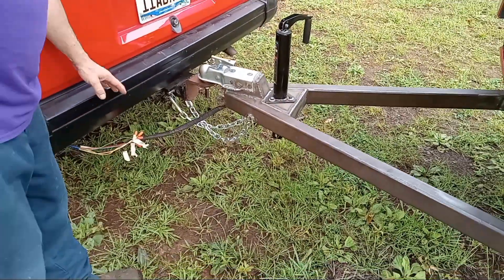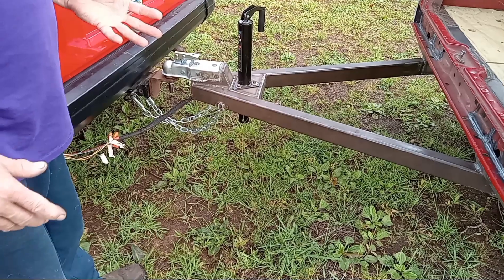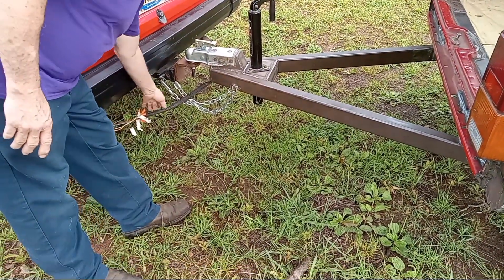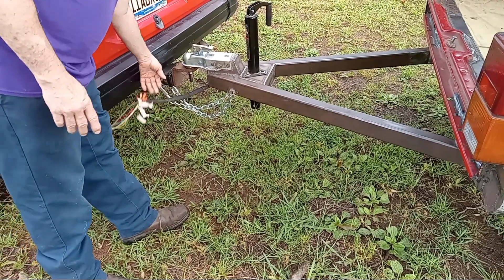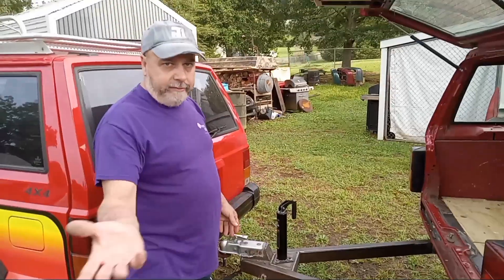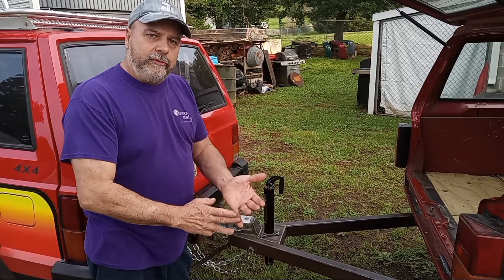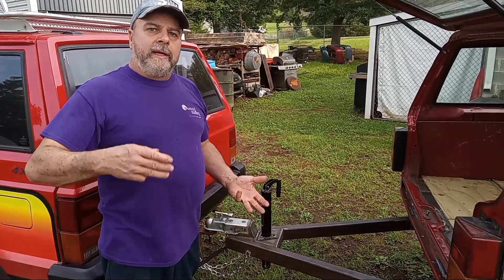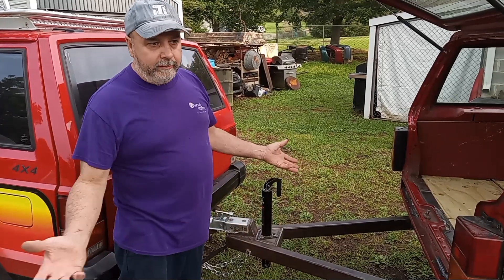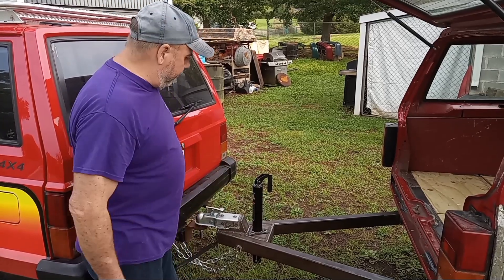Off of this, I fed all five wires. You have to have five different wires plus a ground — so six total. I basically used just an old drop cord from my shop. It's cheaper for me to buy a drop cord than it is six-wire trailer taillight cable, so I'll just buy a brand new drop cord for my shop and use my old drop cord for this project.